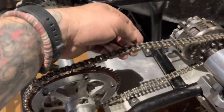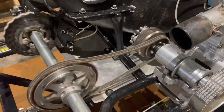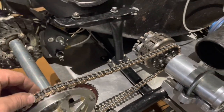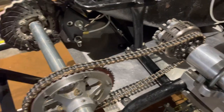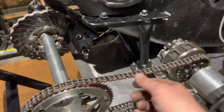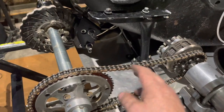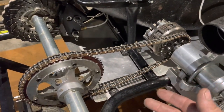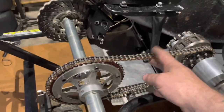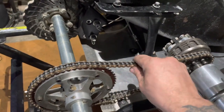And this would be too loose. You are running the risk of hitting a bump and losing your chain. Yes it turns nice and free, but what this has a tendency to do - even on a lower horsepower engine - when your power engages it has a tendency to yank the chain forward. That puts a bunch of wear on your rear gear that you do not want. A floppy chain is not only a danger of actually coming off when you hit a bump - everybody's seen people throwing chains. Chances are their engine got moved back or they didn't tighten it enough.